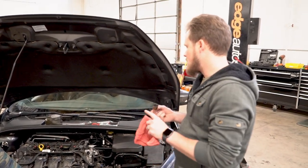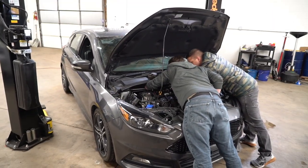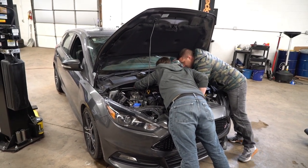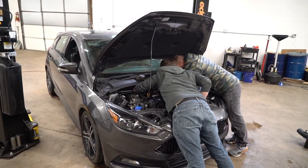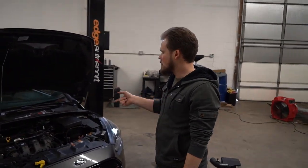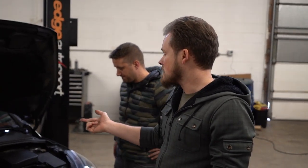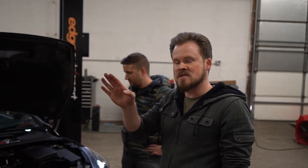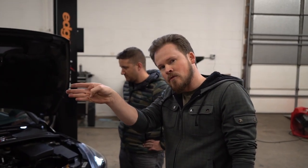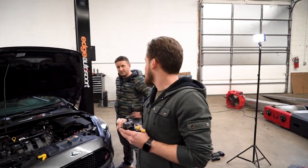We're going to be super careful not to get any crud from the flange down into that area. We put it in sixth gear and pushed it, which rotates the engine a little bit. We were able to see the peak was almost at the top, and as we pushed it rolled over flat. So now it's in a position that is going to be better to install the pump. Next step will be not forgetting to put the cam follower back in.